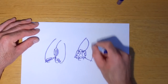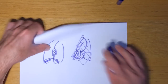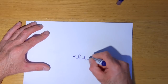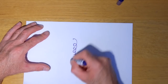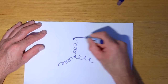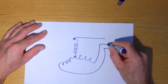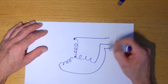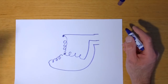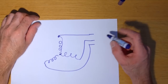Whatever. So ignore that one, because most stuff is wired up as a star configuration. Let's draw a better picture. So, center, and these are representing coils of copper wire. With most bikes, you have three wires coming out of the generator. They're almost always yellow, but sometimes they're white. They're white on this R6 that we're working on at the moment.